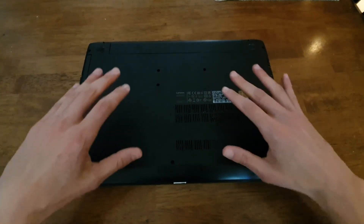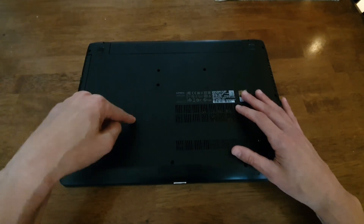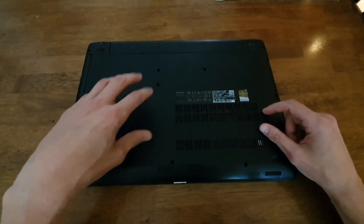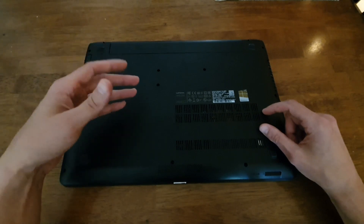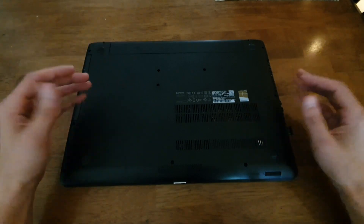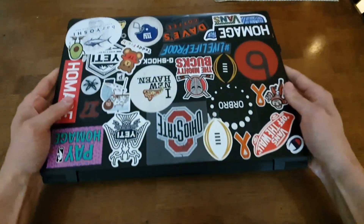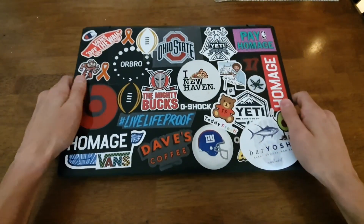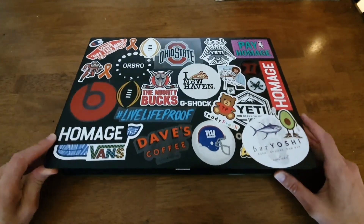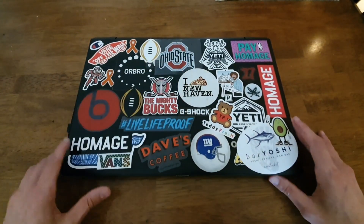This is definitely a budget machine, and for whatever reason Lenovo cut a lot of corners, making it basically unusable. But what we're going to do is some simple upgrades to get it back in running shape. There are 4 gigabytes of RAM soldered onto the motherboard, and we have one RAM slot available. I'm going to put in an 8-gig DDR4 stick, bumping the total to 12 gigs. Not dual channel, but I want the extra headroom, and together with the SSD that should do it.